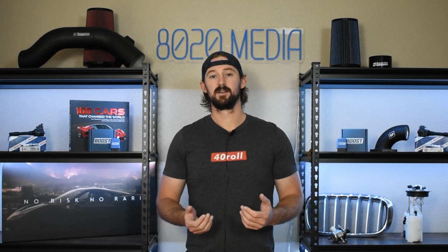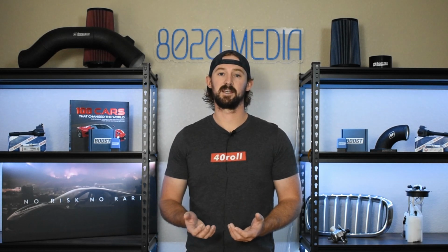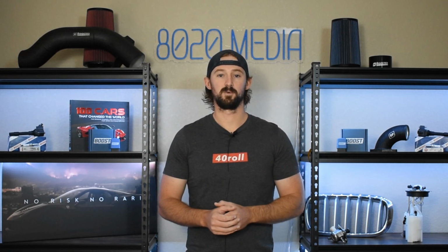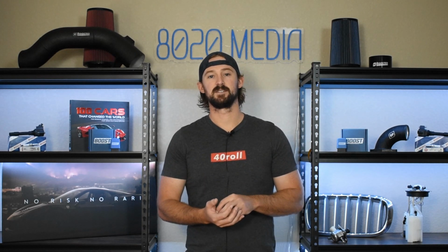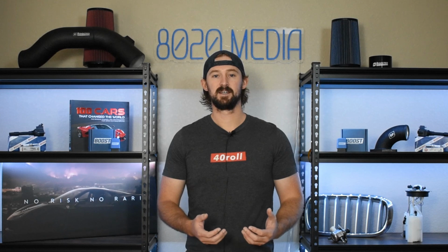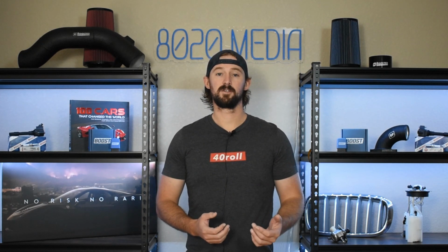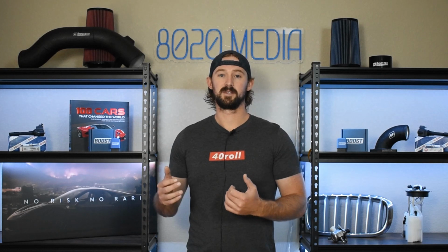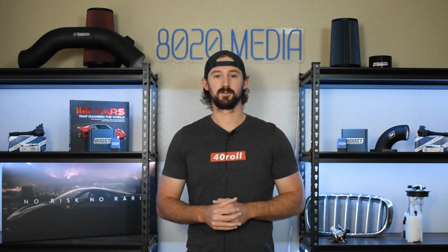But when you factor in the headers, E85 fueling, and tuning, this is what's really going to give you 30, 35 plus wheel horsepower. So these 3 components are the biggest pieces to waking up the BRZ and making it a little bit more powerful and a lot more fun to drive around. But an intake and an exhaust system are absolutely still worth it, because those alone are still going to be able to give you 15 to 20 wheel horsepower, and both an intake and an exhaust system are each going to run you about $300 to $400.